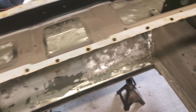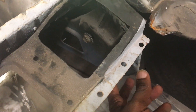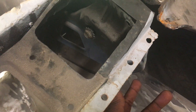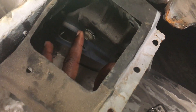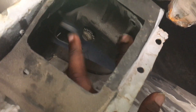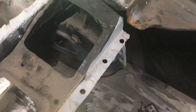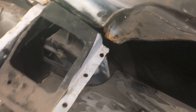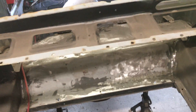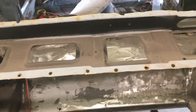That's just a pointer — look at this if it was disrupted. Other than that, this bracket is your trunk lid bracket or hinge bracket. It attaches your hinge — these are your hinge bolts for your trunk lid. You have to remove those two spot welds on it. Mine was pretty much rusted on already, so I just did a little prying and it came out. That's it for the trunk lid filler panel.